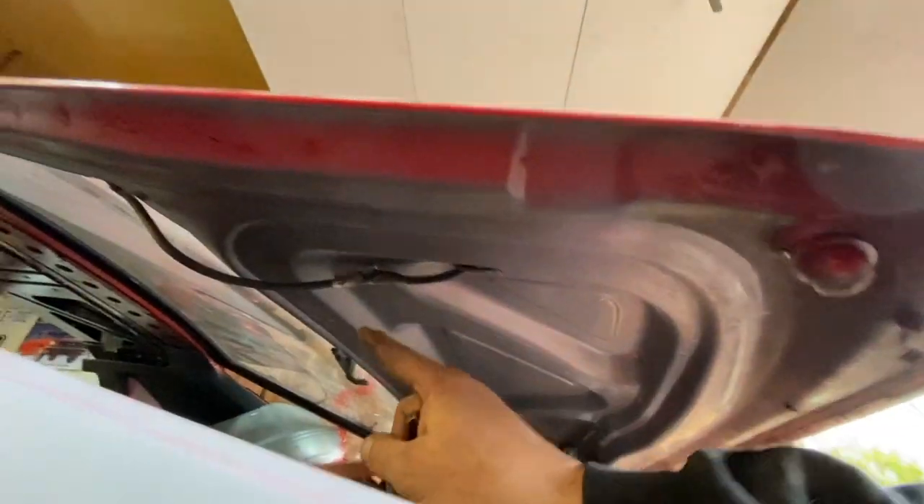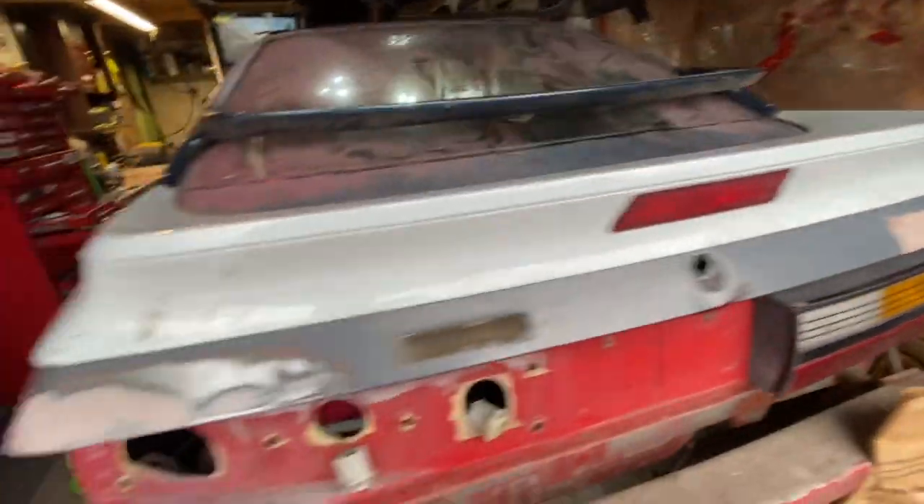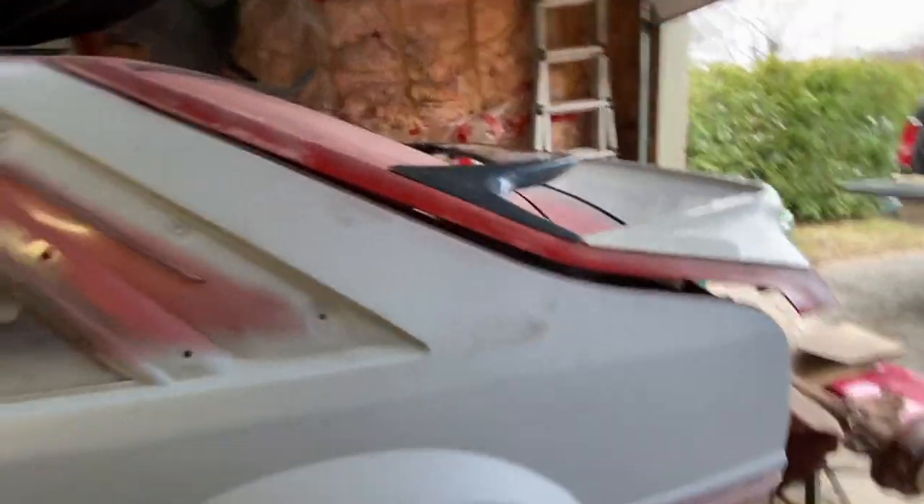Because when they have no spoiler, they don't come with any holes up in here, so we're just going to have to figure it out. I drilled out the spoiler — it's a little rough under there. I had to oval it out pretty good to get it centered, but we'll solve that issue with some washers and rubber grommets. I have it mounted now. I'm going to show you what it looks like right now — it's not fully bolted on, but there's the spoiler on the car, sitting flush. You can see the SVO spoiler.